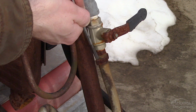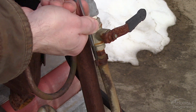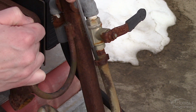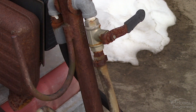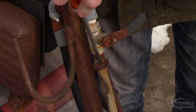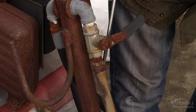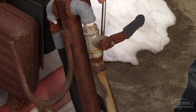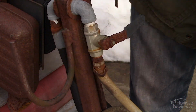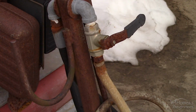First is using a standard screwdriver. While I'm not typically a fan of using a standard screwdriver as a pry tool, yes, it can be done. However, I would be extremely careful here. This should be only used on connections which won't break, such as a steel hose barb. If this is used on a plastic type fitting, there is a good chance you'll end up breaking it. Find the appropriate size screwdriver, then force it into the crimped ear and slowly pry it open. Another risk is having the screwdriver also slip. This can result in harm to yourself or damaging surrounding components, so take extreme caution when using this method. Once done, the clamp can be slid down and then the hose can be removed.